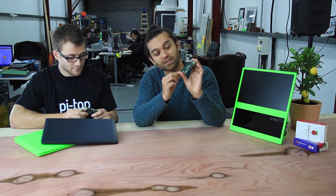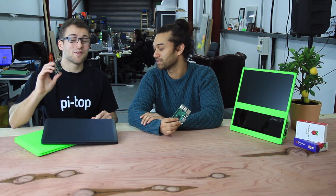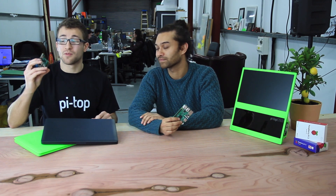This guy's got some new upgrades we're going to be looking at, starting with the processor which is a next-gen quad-core Broadcom 2837 chip. We're moving away from ARMv7 architecture, which is on the Raspberry Pi 2, to ARMv8 architecture on the Raspberry Pi 3. Now we've got a 64-bit chip, which means you're able to access a larger area of memory at once, and most of your applications are going to be running a fair bit quicker.